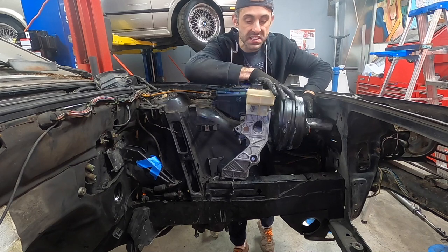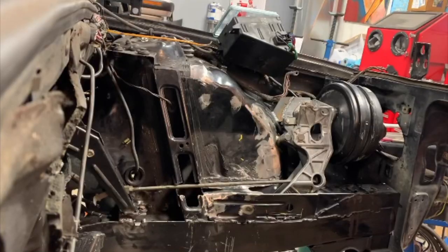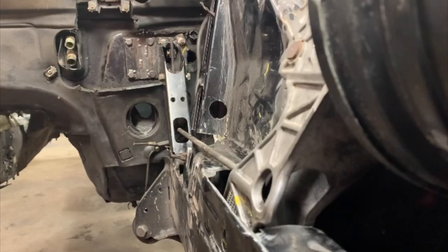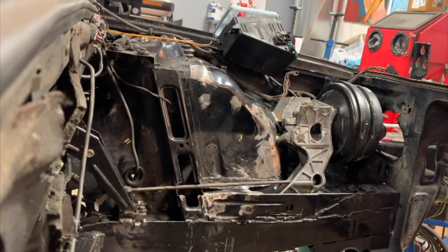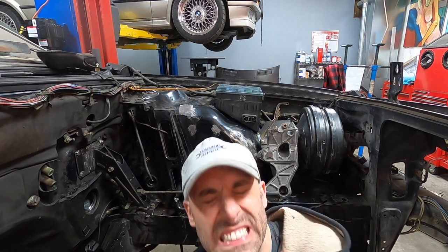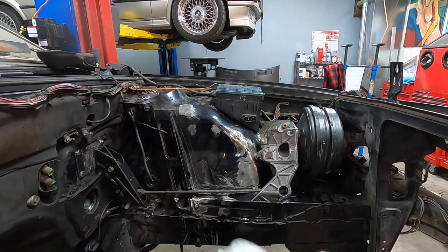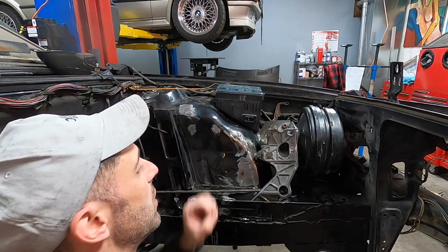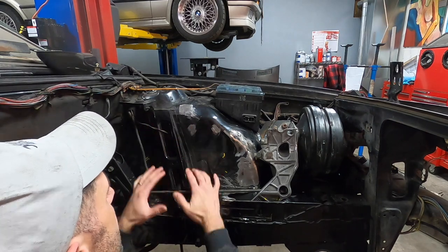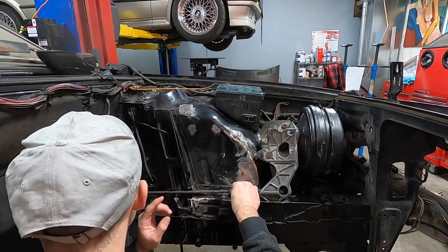This bracket needed to be lengthened and pushed over about an inch and three quarters in order to make room for the V8 cylinder head. The trick is to make sure this assembly is as far down and as far forward as possible without having the master cylinder interfere with the driver's side headlight. The brake system is now complete. There are a couple of finishing touches I still need to add, like the reservoir location. I need to beef up this structure since I did cut it, so I'll have a bolt-on solution right on this face — no big deal.